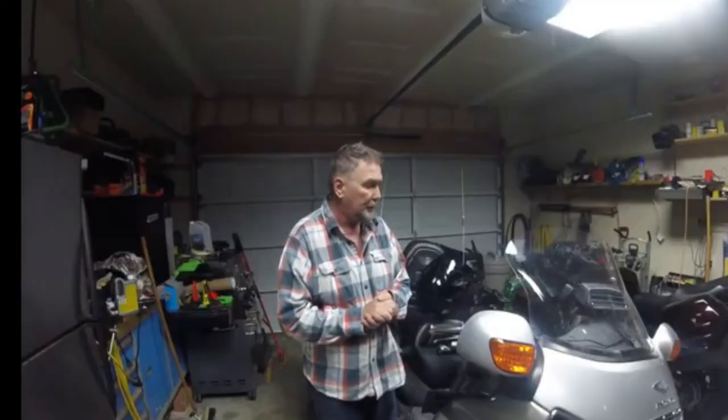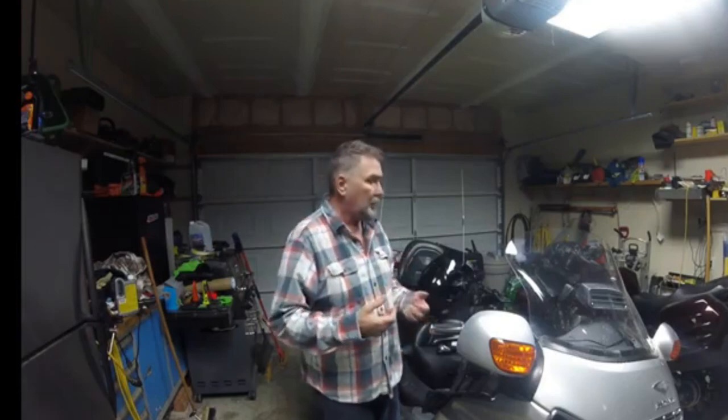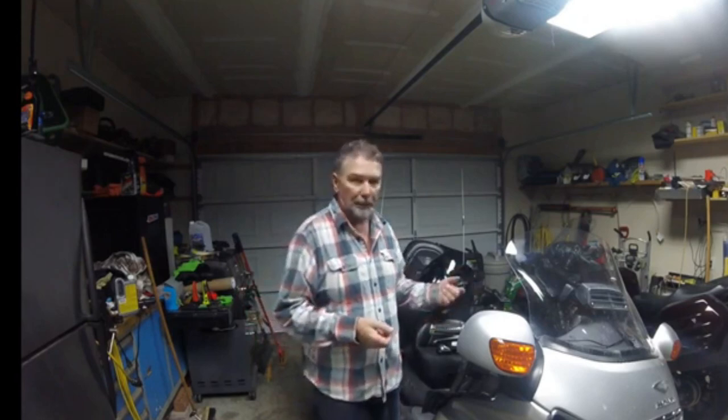As it stands right now, if I only ride with two or three riders, we can ride in Bluetooth mode, even with our Pack Talk or the Smart H that we have that do have DMC as well. So we can use the Bluetooth mode only when we have to go to DMC with a larger group, which may never happen. Then I would have to bridge to the Q3 if I wanted to use the CB while on that trip. If I don't necessarily have to do it, I can leave it off and just not have the CB unless I need it.